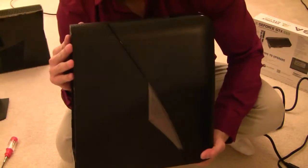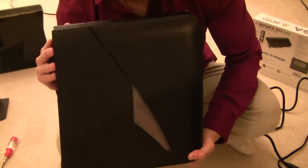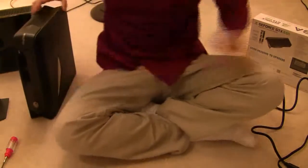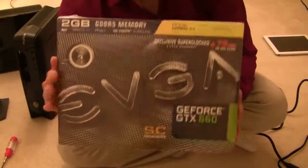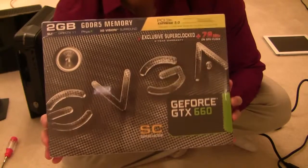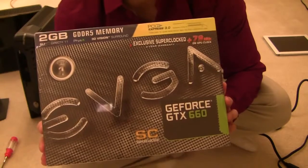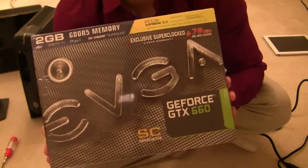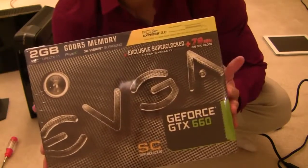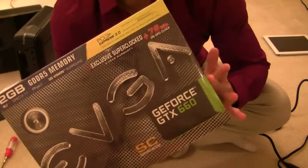This PC came with the GT545 graphics card, which was a pretty good card for 2012, but going into 2013 we need something with a little bit more punch. Enter the GTX 660. This is the largest graphics card that is endorsed by Alienware to use with the X51. Some people have managed to use the GTX 670 with the Alienware, but due to power concerns they have to underclock the GPU so much that you can just overclock a GTX 660 or GTX 660 Ti to achieve similar performance.